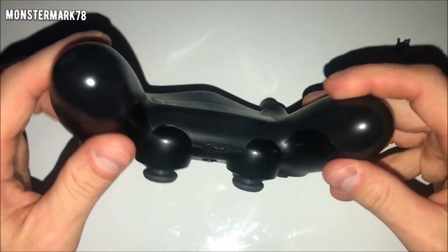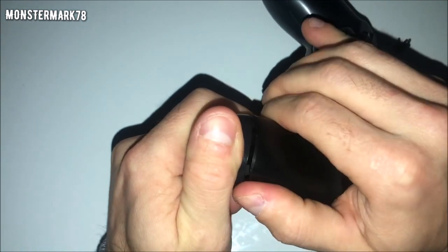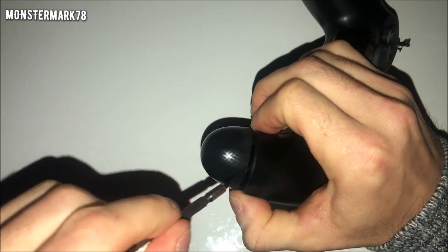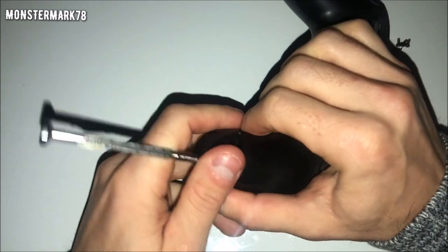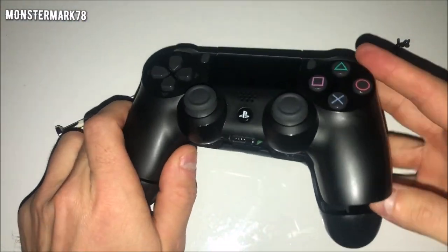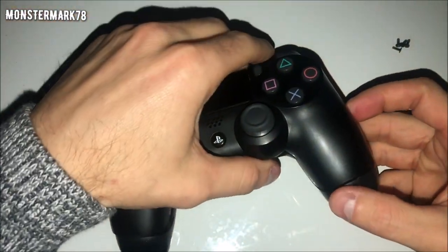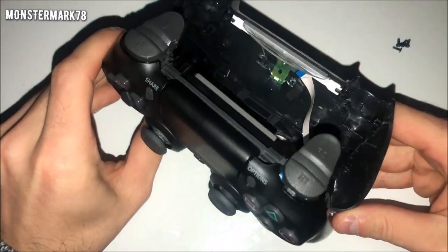Next is taking the controller apart and opening it up. You're going to take the edge, pull it down, squeeze, and try to get a grip. If you need to, you can put a screwdriver in just to hold it so it doesn't close back. Pinch it, then pull, and it will open up. You can do one side and the whole thing will open, or do both sides. Just make sure you're taking your time and not yanking it.